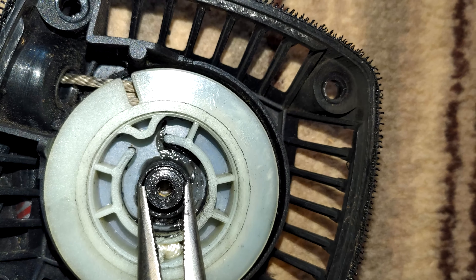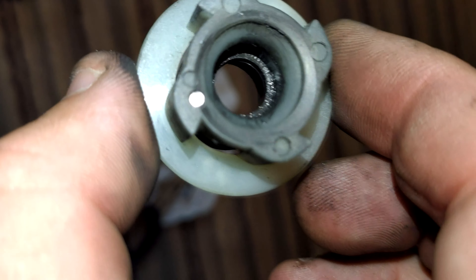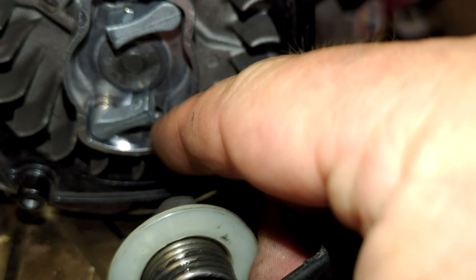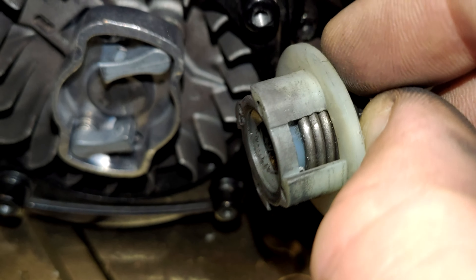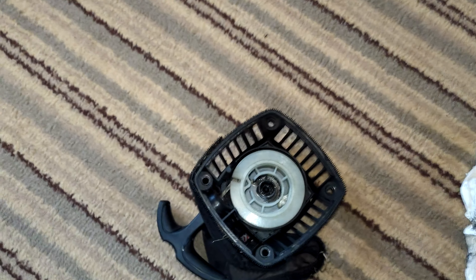When this breaks away, even though the top part's screwed in, it comes forward. That's why you get all that aluminium-looking dust — this is falling forward when the engine's running and rubbing on the inside. So that falls forward into there and catches. Then when you pull it, it can't drive because the spring that locates into the top drops back, and your little drive gear, rather than being able to engage and push the engine round, is just spinning.